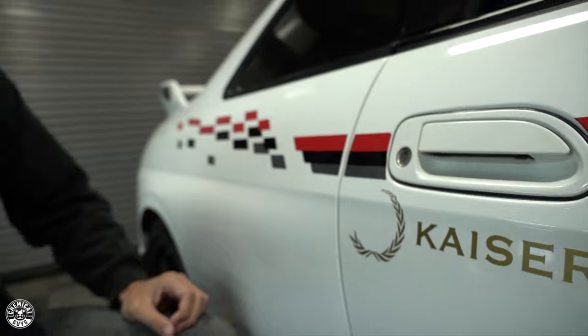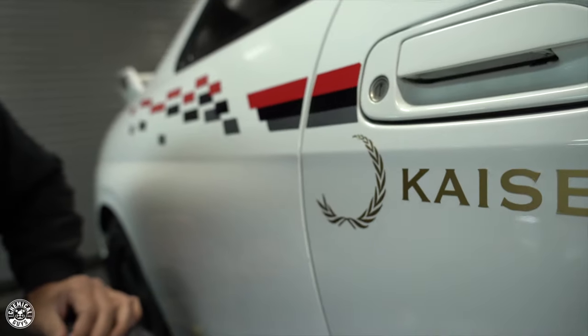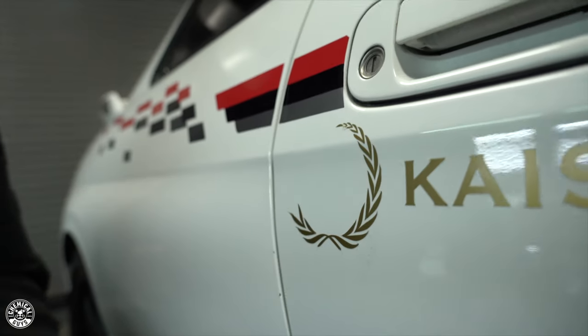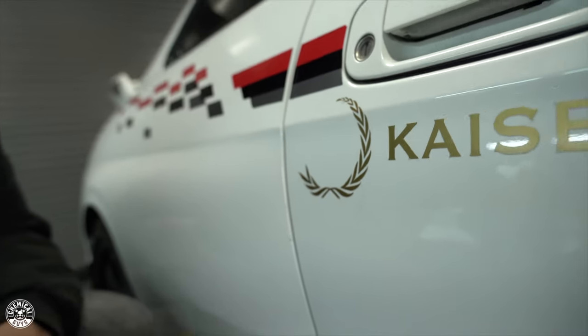Now we'll take a clean towel and check our work. And there you have it, nice and smooth. The letters have been removed without having to scratch it, and now we don't have to polish it. So this is, again, the easiest way, as well as the right way, to remove your vinyl lettering or decals so that you can either apply new ones or just change the whole look of your vehicle.